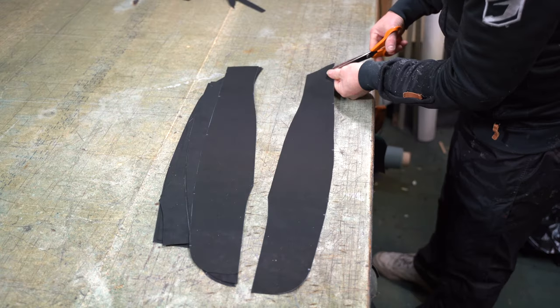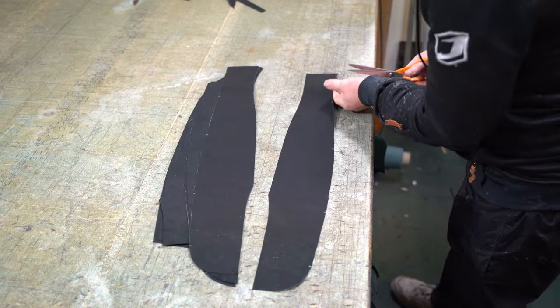So that's all the pieces of Alcantara cut for both front passenger and driver's seat. I need to cut the match marks in and then foam back them, and then all I need to do is cut the centre panels out for both seats from the golf tartan, and then I can start sewing them together. So I'll cut the notches in first and then foam back them.